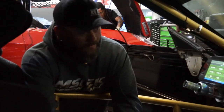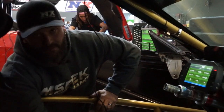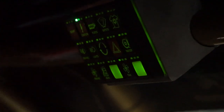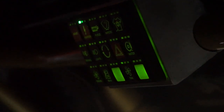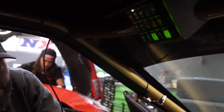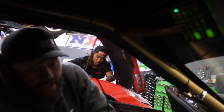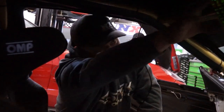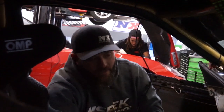There's really only two components to them. You have your main control box, which on this car is mounted down underneath, and your switch panel. This is a CAN keyboard and user definable. They all come blank like this. You actually put the stickers on, you tell it what to do. You put the sticker, the button orientation, what you want. You can get different keypad amounts. I think there's a 4, a 6, 8, a 12, and a 16 button for MoTeC, and then ECU Masters, which is the other PDM that I'm familiar with and we use, I think is a 4 and an 8. I might be wrong on that, but anyway, there's only the two components to it. Wiring it is pretty simple.